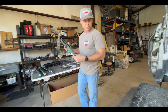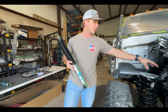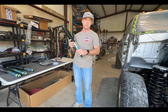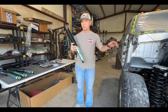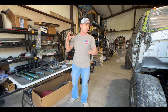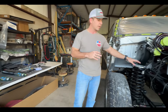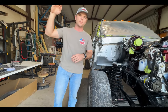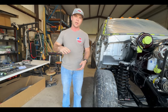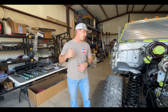We have about four inches of lift but we deleted five inches of shock travel, so that equals out to a negative one lift. This Bilstein part number is designed to run on Dodge trucks with a plus one to negative one lift ratio. Right now the ride height is about 20 inches — extended length all the way up is 25 inches and fully compressed is 14 inches, so right in the middle I get equal travel both ways on the shock.